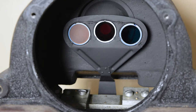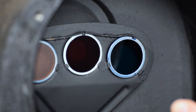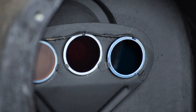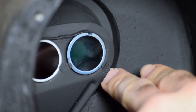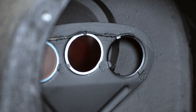It's just sad that little by little searchlight signals are disappearing from service. But let's continue on replacing the green roundlet with the lunar white. Inside the mechanism, the roundlet lenses are just held by one tab and sit on little tabs. You're going to have to carefully lift the tab up — it's soft brass so be very careful not to snap or bend it. Then slowly and carefully lift the roundlet out of its spot, and it just pops right out.